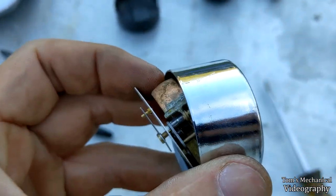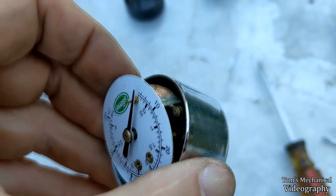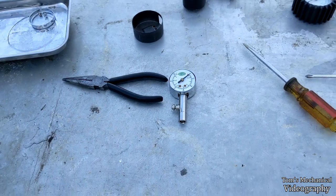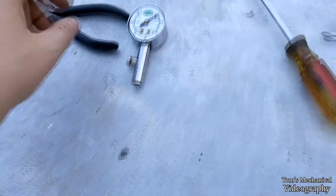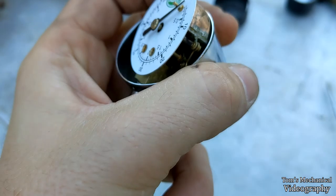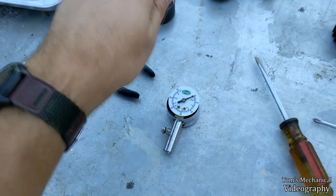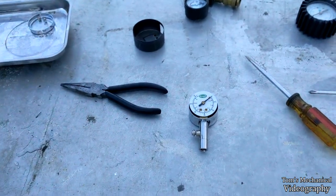Really all you're trying to do is take this bladder and bend it ever so slightly up, or take that little arm and bend it ever so slightly down to recalibrate it where you need it. I'm going to recheck it on the car first, then take a pair of needle nose pliers and bend that little arm just a tiny bit, then recheck, then bend, then recheck — until it's reading right where I want it.